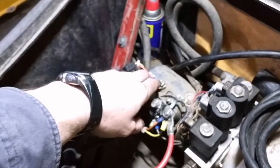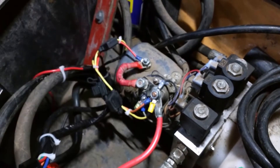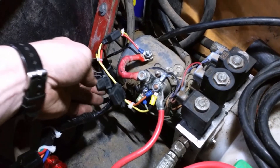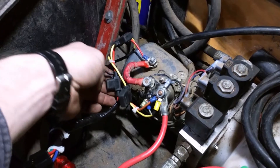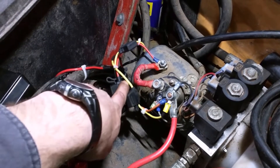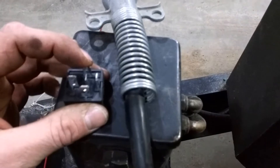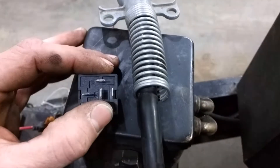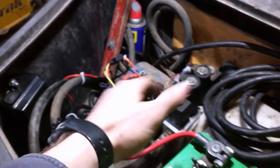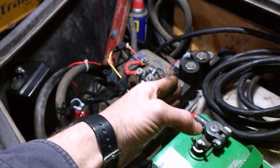Take the positive off the working end of your pump — you only want to activate the coil when the pump is running. Run that wire through a small 3 or 4 amp fuse, since all it has to power is the magnet in the relay. Then run it up to your harness. On your relay you'll have a hot coil terminal and a ground coil terminal. Whenever you activate your pump, it tells the relay to cut the battery off from your truck, and simultaneously sends juice to your test light.